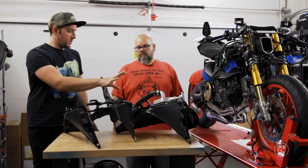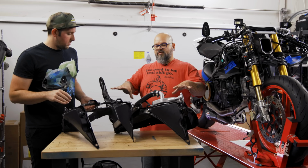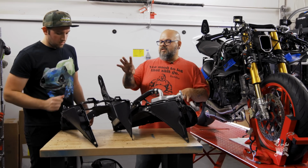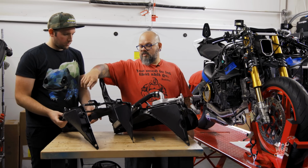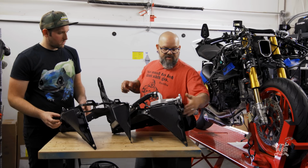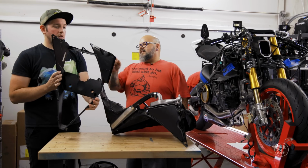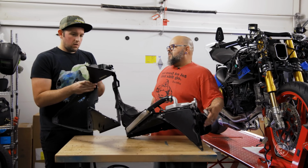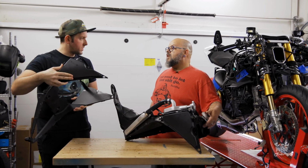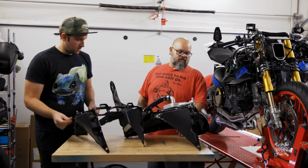I imagine our first step is to remove the fan and then get the radiators over here. We're gonna remove both radiators off of this, and then we're gonna have to swap over all the little bits and pieces that this does not come with. There's some rubber grommets, there's some speed nuts that slide onto these two, and then there's these little, I'm sure you guys remember, these little sprung doors that are in here and need to get swapped over to this as well. It's gonna take a little bit longer than I thought because I forgot that these little spring things were on here, and I didn't realize that didn't come with them. Well, I didn't realize that this reservoir was actually part of the brace. That's surprising. Okay, cool. Well, let's get to it then.